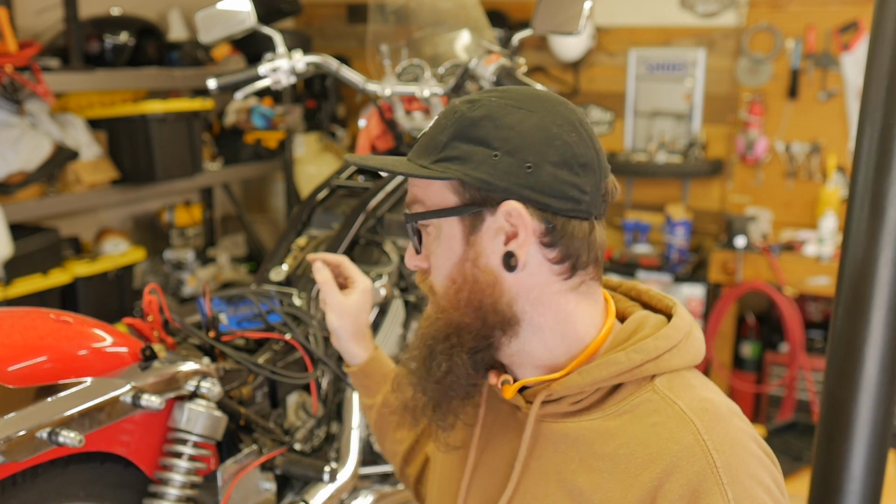Fighting over either it's a 64 or a 63, I'm not going to waste my time doing that, neither should you. But if it was way off and you were making these huge full turn in or a half turn in adjustments, shut the bike off, snap that throttle a couple times, and keep repeating this process. You may find that the main RPM is going to change, just from what you're hearing or what was on that digital readout, which is pretty cool that they have an RPM readout on that. I didn't know that it had that. But make your adjustment. It's okay to constantly be changing the RPM of the bike. Or you may make a big adjustment and it will just go real low and shut the bike off. Turn the idle up and rinse and repeat.